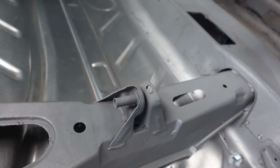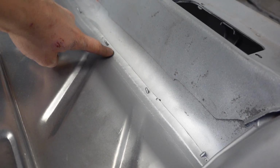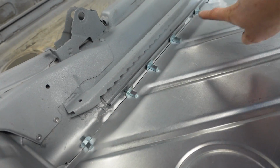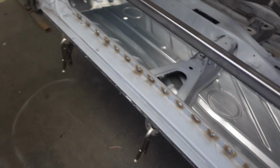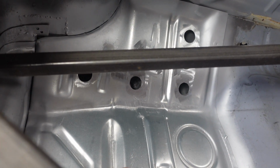That's on. So you can see here this flange that I've put on and where the screws are coming through, and that we're going to weld on. These clamps down here are holding this in place. We've got the clamps on the back. And then this obviously needs pushing down, which is not quite in the right place, but we'll get that in. And then up here, we've cut all this lip off. We're going to knock this all back and then seam weld it all into the car.